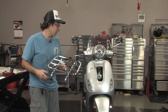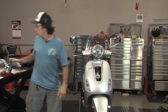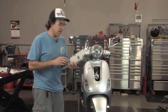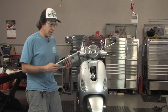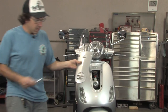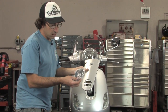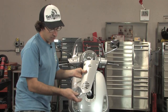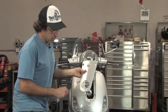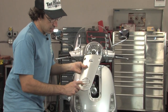The only thing is this requires a little bit more modification to the bodywork to make it work. First of all, you need to modify the horn cover that's on your LX. If you have a newer LX, it's going to have a little chrome embellishment in the front, and the rack includes a new style chrome embellishment that already has a slot for this bolt to pass through. You can see on this one, on the second to the last row, I notched it out — took a small coping saw and cut that out.